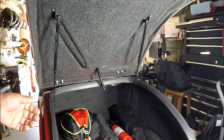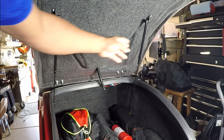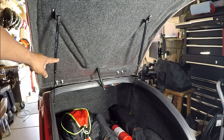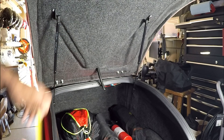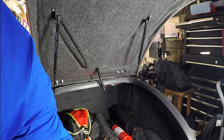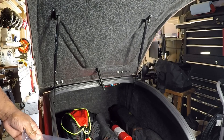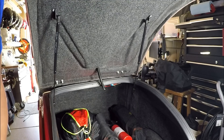Hey, what's up YouTube, your boy Chris in the Caliente garage. In this video I'm gonna be changing out the left and the right gas spring on my ion trailer lid. These are the original gas springs that came with the trailer — they come with a 60-pound lift and extend about 20 inches. I'm gonna be replacing them with some struts I picked up online at Walmart. These come with a 50-pound lift but they extend out about 23 and a half inches.